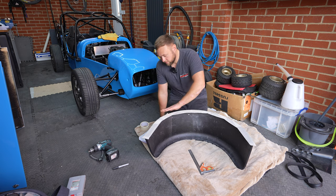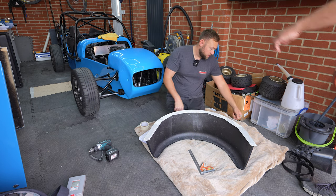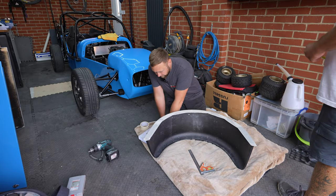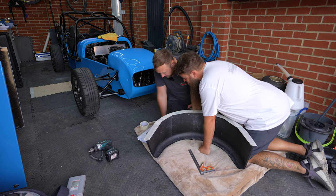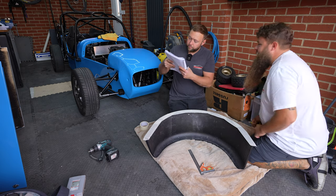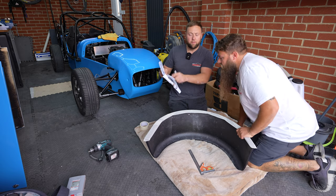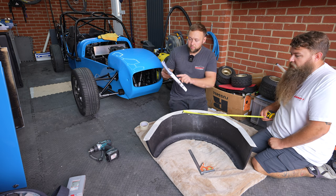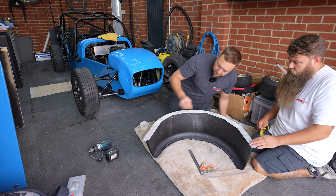So according to the guide, and we do have a tape measure. So the measurements: at the front there are more fixings than at the back. We worked that out - obviously you're not going to be doing 100 miles backwards. So we go 55mm up. What Rob is going to do is, with his set square, mark the centre of the gap. The gap is about 40mm in thickness so we're going 20mm - about three quarters of an inch. We'll see what that looks like, it's about 19mm.